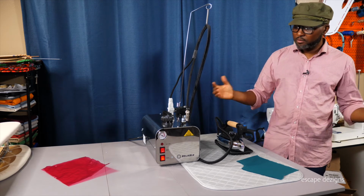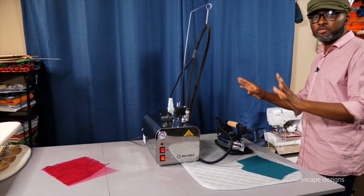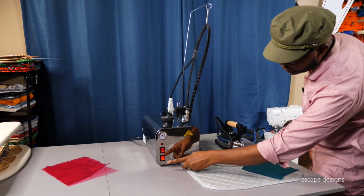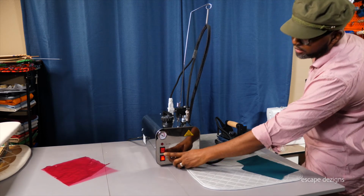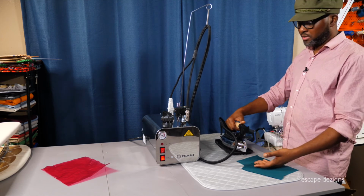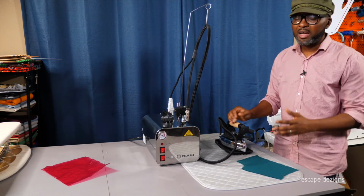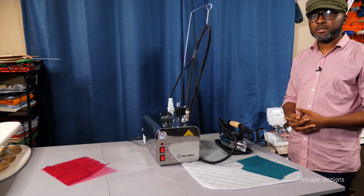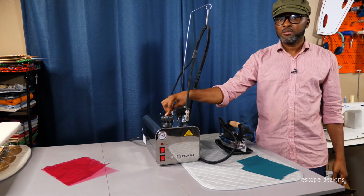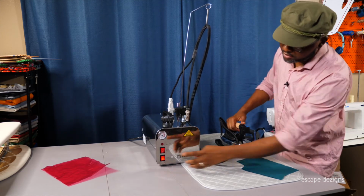Now that I'm done, the first thing, once you're done for the day and ready to turn off the iron, you turn off the boiler. Once the boiler is off, you can still use the iron to do any other finishing job you want to do. After that, you turn this one off and allow it to cool down for like 30 minutes. When it's cooled down, then you can release this, because we want to make sure all the steam is released. All right.